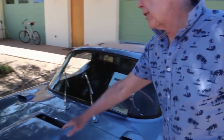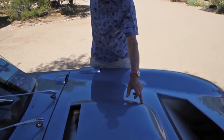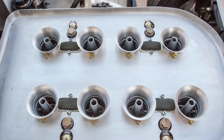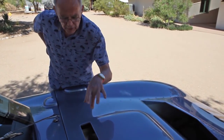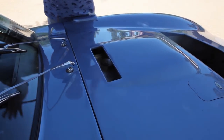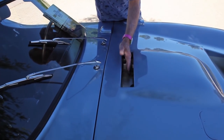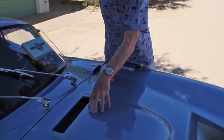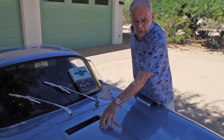Here's where you put the oil in during a pit stop so you don't have to pop the hood — you open this up and inject more oil. This hood scoop was really built to clear the Weber carburetors and give an equal height of the bodywork above each carburetor bell mouth. This is the entrance area for the air that goes into the carburetors. There's a real high pressure area up in front of the windshield where air builds up and jams down here. They had foam rubber around here at one point to seal off the air scoop area, but the pressure was so high it blew it out.